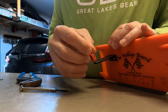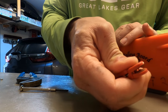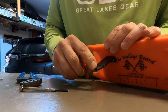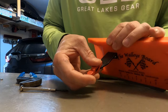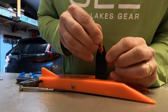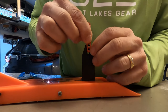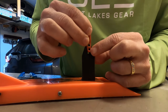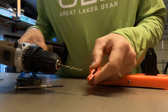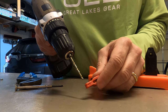Like I said, this is an OR16 — it's red — and it does have that pin in there. The cool thing is this little knob right here fits right inside this guy, but the holes don't match up. You can see that open hole, which we're going to be JB Welding closed. We still need to drill a hole right here. I found a drill bit that fits perfectly in this — I don't even know what size it is, but I had a wide range of drill bits and it fits.